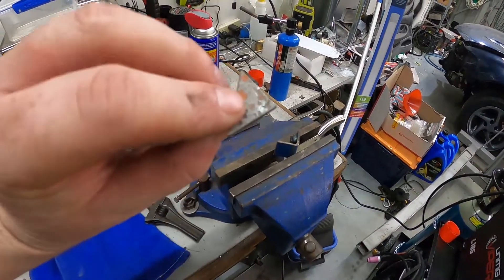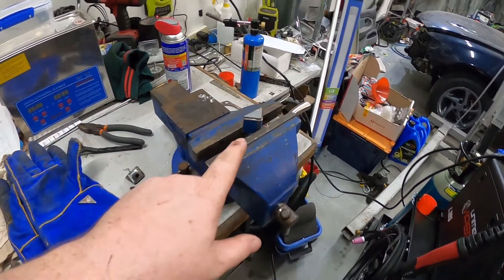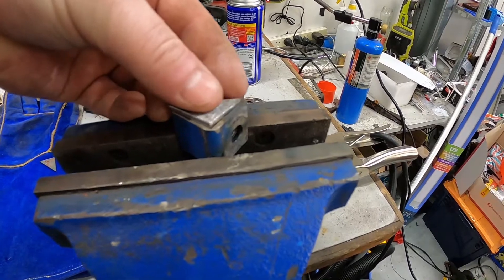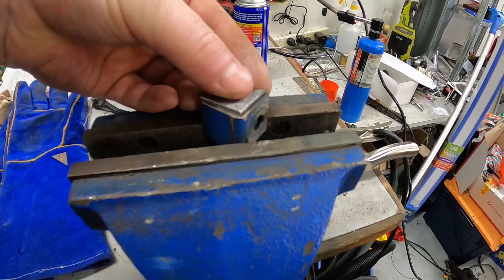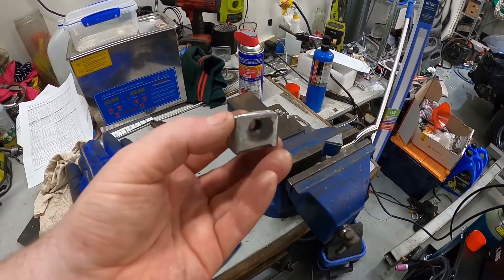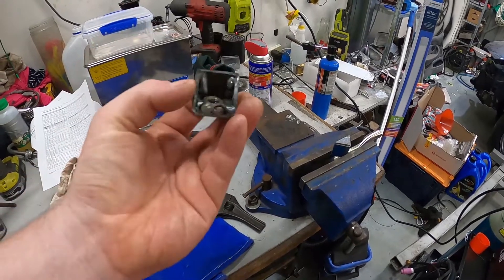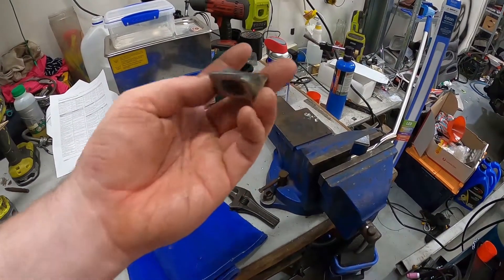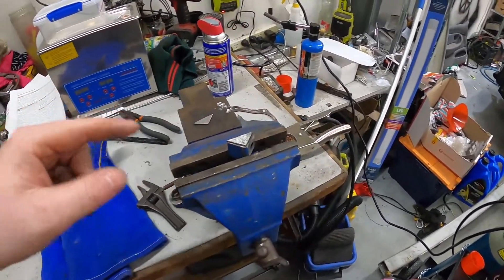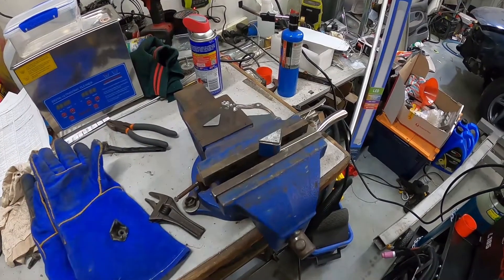All I've done is cut out this little triangle — I've cut out a couple of them. The first one I just welded the whole plate to it and then cut it out afterwards, but I found this way is actually better because it gives me a sort of divot to fill with weld, which will make it stronger. I'm learning as I'm going — I'm no professional welder. But this one is done. It doesn't look pretty by any means, but boy, it'll be strong. I shaved it off, got a new linisher outside so that made quick work of that. That should be good enough to weld to the chassis. I'm just going to weld these two sides on, then fill the inside with weld to make it stronger, and then I can worry about cutting the old ones off the car and welding these ones on.